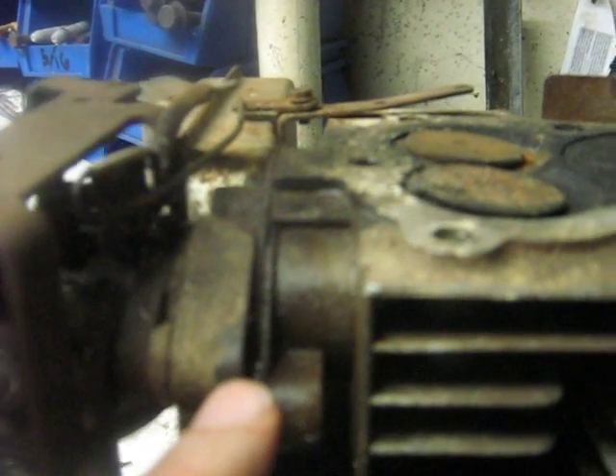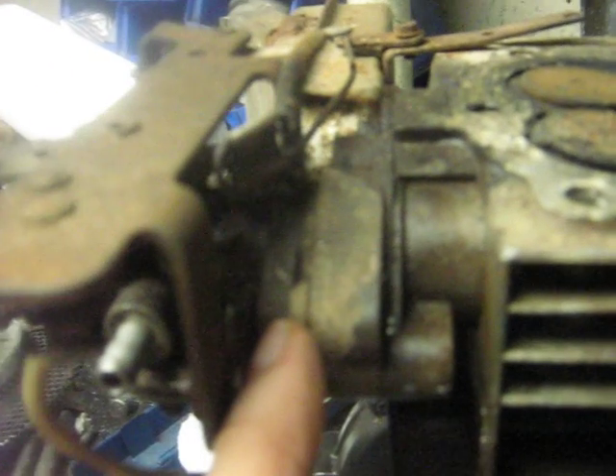As you can see, I've got the bowl off there. It came off all right, but trying to get these bolts — I've got one highlighted right in here. You have two nuts: a nut there which I got off, but I can't get the one off on this side. That nut comes through into this other housing, and on the back of it there's a Phillips head countersunk screw. That holds the carburetor to this intermediate piece, which then bolts to the engine with two more Phillips head screws.